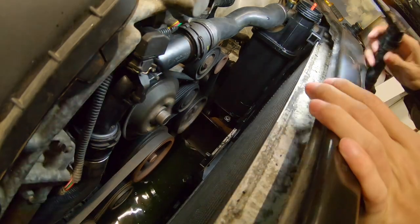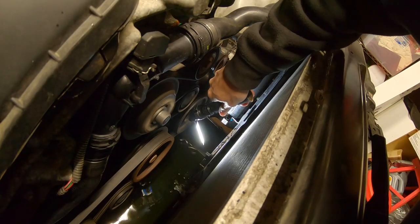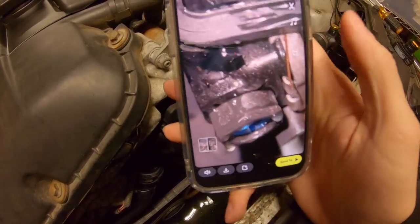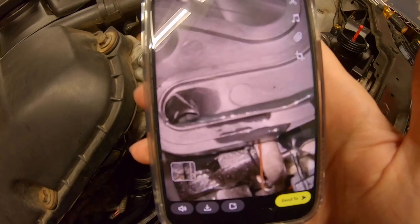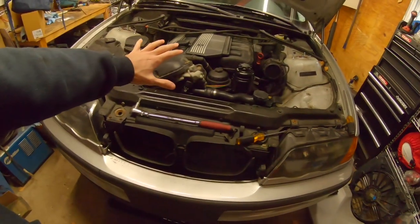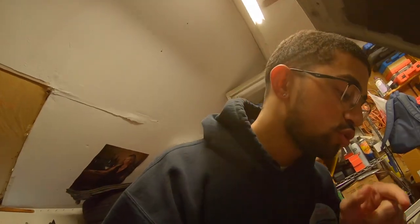There's an open hole — I knew it. I'm going to do some research. I was working on the E46 over the holidays and I can now head over to FCP to get a new drain plug, because apparently the drain plug between radiators of an automatic and a manual are different. The automatic has the long drain plug so that it allows coolant to flow to the automatic transmission cooler, and the manual has a short plug. The short one actually blocks off the radiator flow — it's not how you'd normally think it works.